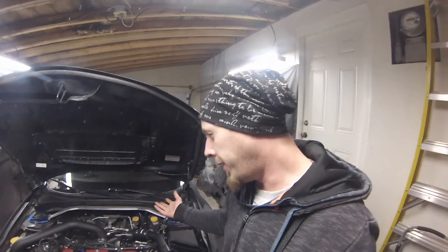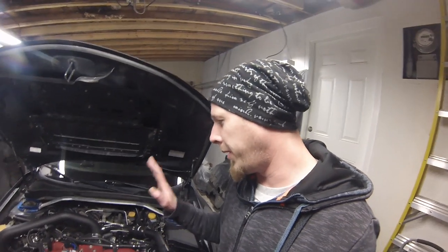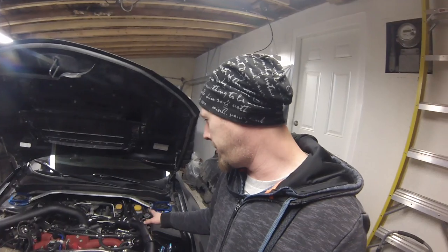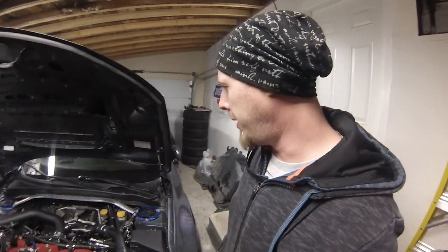Okay, so I've got the heater hose clamps changed out, did leak out coolant, gave a good spray of air to try and get rid of all the excess coolant that's built up. Got the new clamps on and the system refilled with coolant. They appear to be dry. The hoses still feel nice and dry, so hopefully they stay that way. Be something to keep an eye on.